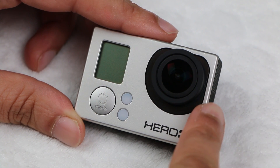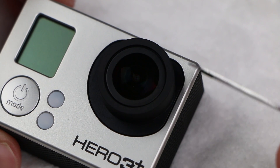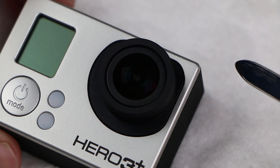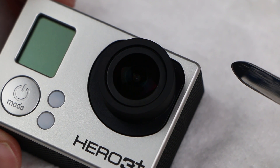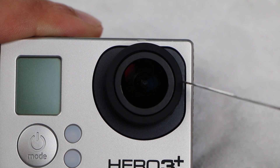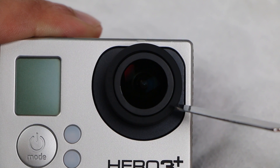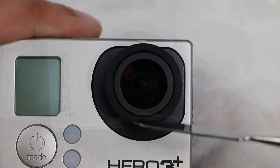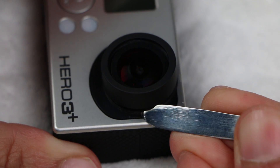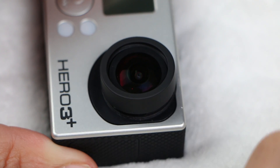We'll be concentrating completely around the front of the camera up by the actual lens itself. We first need to remove the plastic housing around the lens. You may wish to apply some masking tape around the lens on the actual camera body if you like, but if you're careful you shouldn't really need it. Now the outer ring has three clips holding it in place — one's in the 12 o'clock position at the top, one's in the 4 o'clock position, and one is in the 8 o'clock position. Insert your prying tool — even a flat head screwdriver will do — into each clip position and gently lift the lens ring upwards away from the lens.